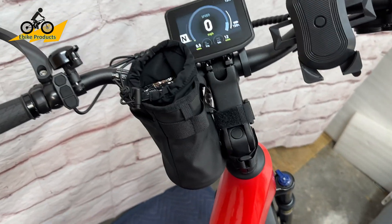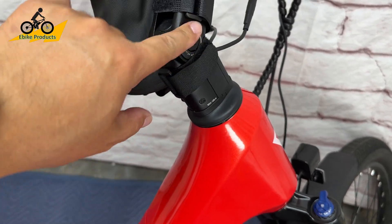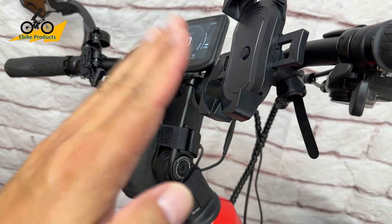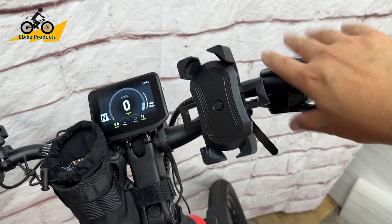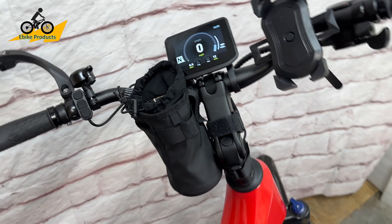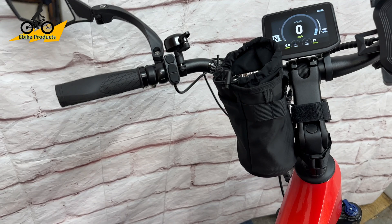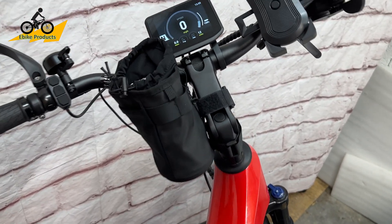The dashboard is paired with an adjustable stem, so you can adjust the neck angle up and down and closer to you. I had it all the way up and adjusted the handlebars angled toward me, then tightened down the brakes in a comfortable position. This made it easy to ride without any reach issues, which would normally be a problem on bikes that are too large.